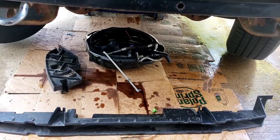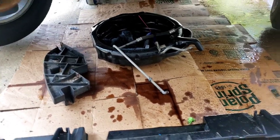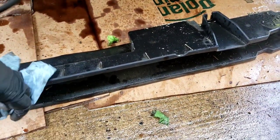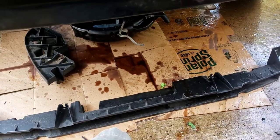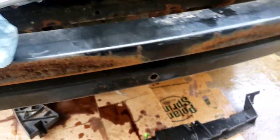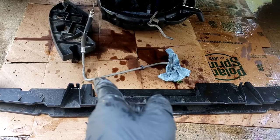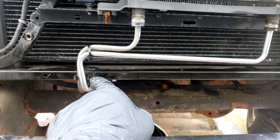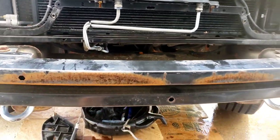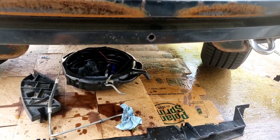I'm just going to leave that clip off. But there's that line. Alright, so here we go — it's running. Looking for a leak. Believe me, it'll be pissing out right now — it's under transmission front pump pressure. So if it was going to leak, it will leak. Goes down underneath over here. Follow the lines, make sure they're not rubbing each other. It's a little longer here, that's why it misses this piece, but I wire tied it and it's leaning on this plastic — it's fine.